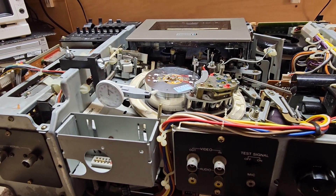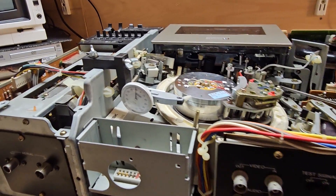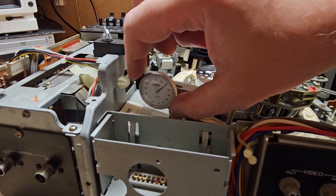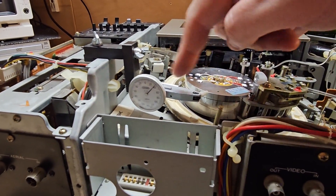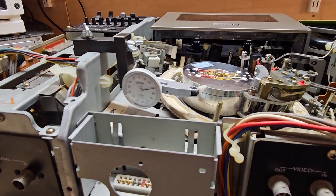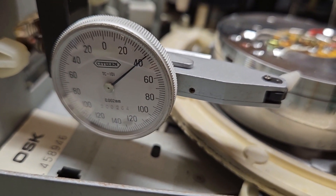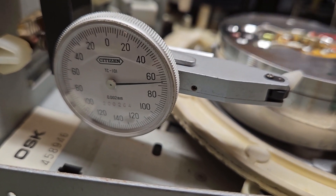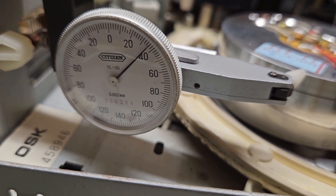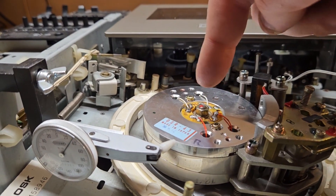Because when it was playing, something in me said it didn't look right. But that's as best as I'm going to be able to do with the tools. You can also adjust this thing here to try and zero it out, but getting an accurate frame of reference is difficult. What I've learnt over the years is not to worry about that, but look at the consistency of where the needle is as you're turning the disc smoothly. As you can see, it's pretty good — if it were out, it would be moving back and forth like that.